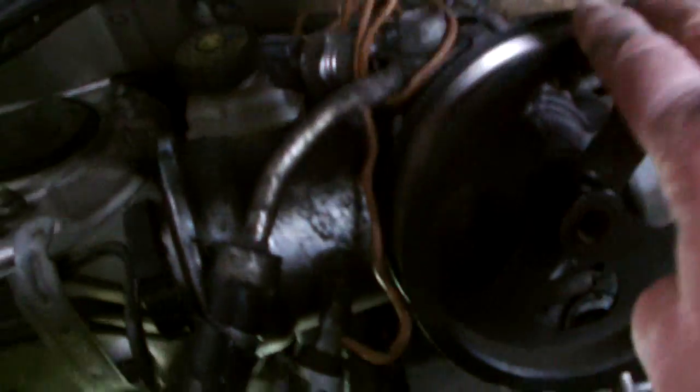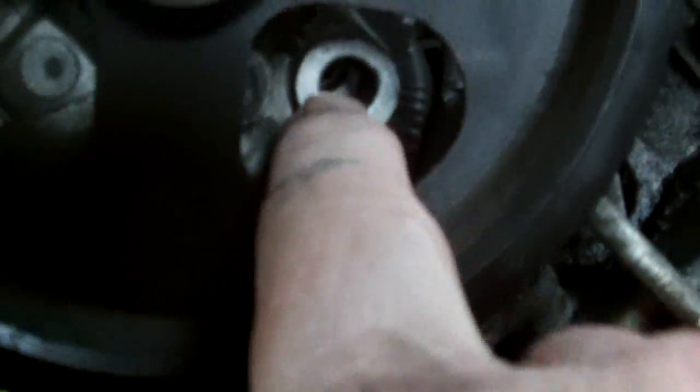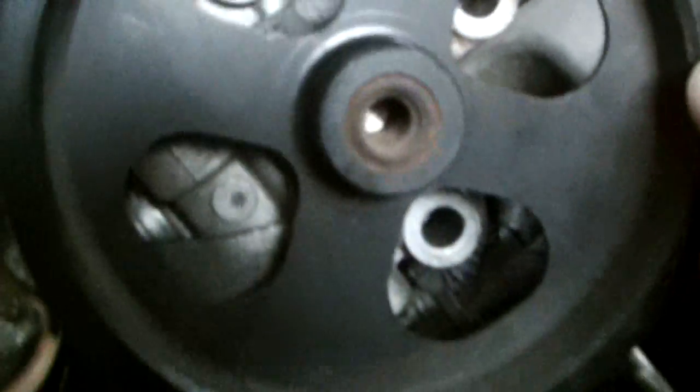So we have to get off the power steering pump. We'll cut the wrap just to get off the plug here. Leave the pipes on, and leave a stud here and a stud here. Remove the two long 12mm studs and the pump comes out of the way.